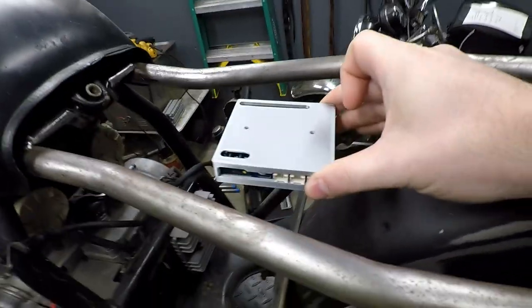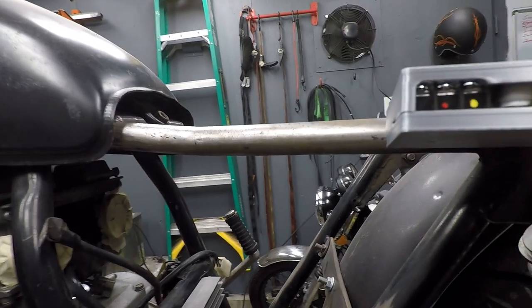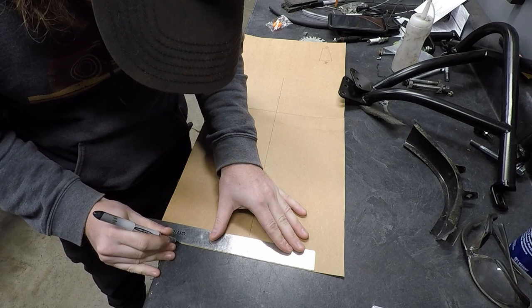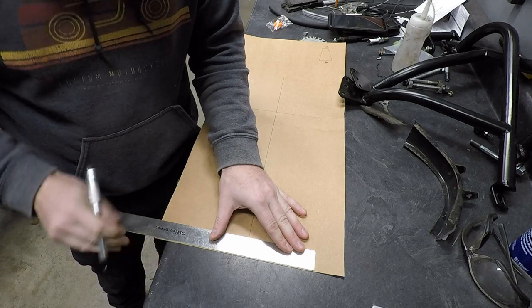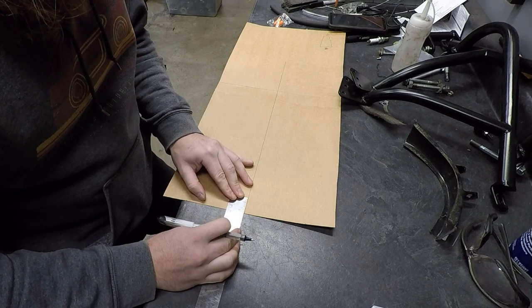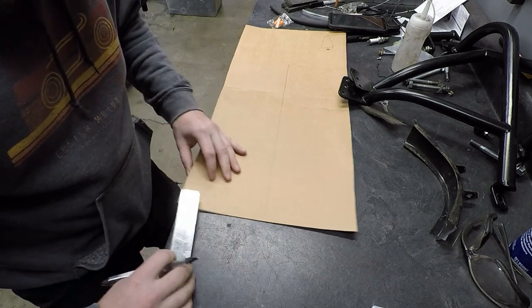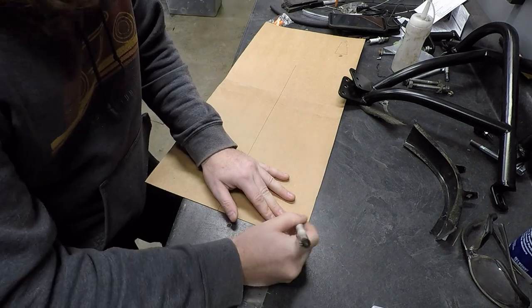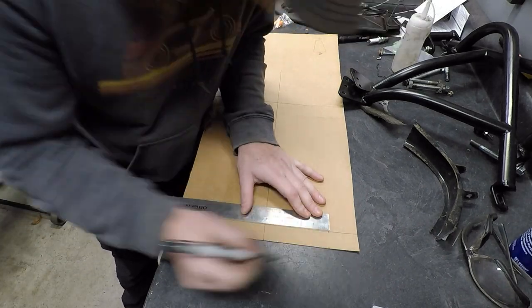You need to determine exactly what you're going to be putting in the tray. For me, I'm only going to be using the X-21, which has a very low profile, making it super clean. We can make the tray really shallow — shooting for about an inch and an eighth total height. You add that inch and an eighth on the side of your base plate to fold upwards, giving you your depth. Mark out your center on the cardboard, draw your base, then extend that by an inch and an eighth to give you the sides that fold up. This bike went 11 inches in total length, eight and a half inches wide in the rear, and four and a half inches wide in the front.